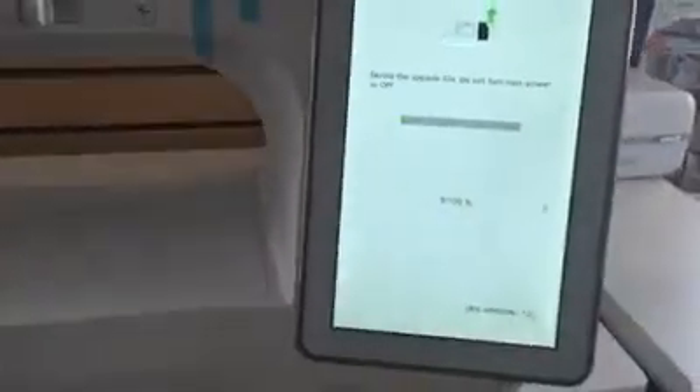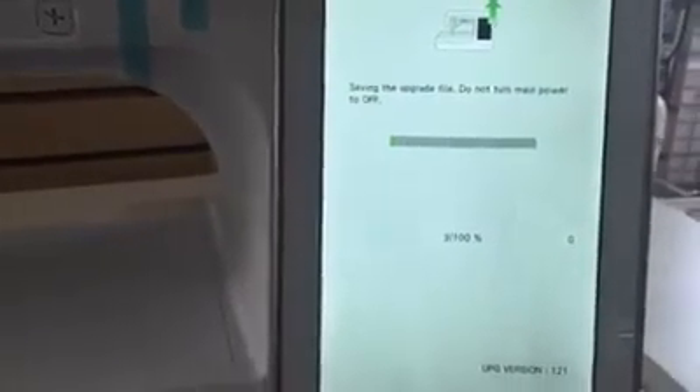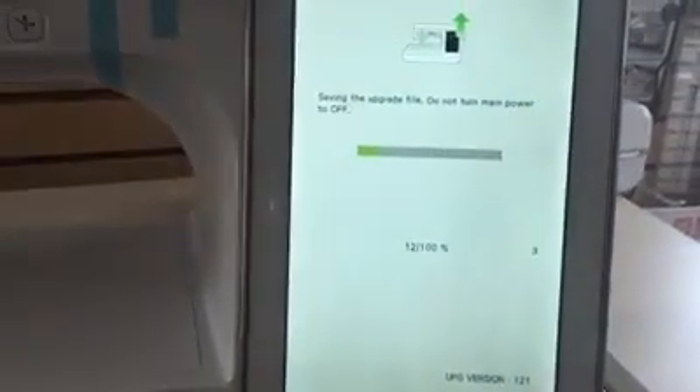Touch the word 'Load' and wait. One thing to note: if you have a foot control pedal plugged in, unplug it before doing this update — just one less thing connected. The progress bar will hang at around 15% for what seems like a long time, and then jump quickly from 15% to 100%. Just wait for it to hit 100%.